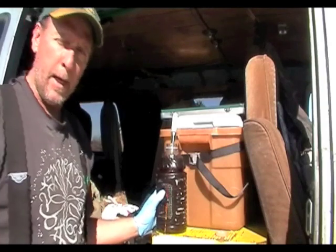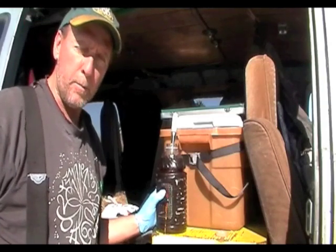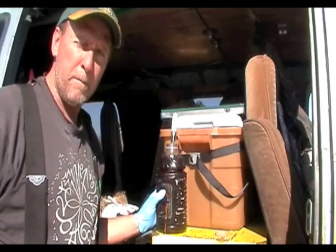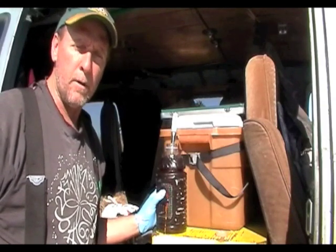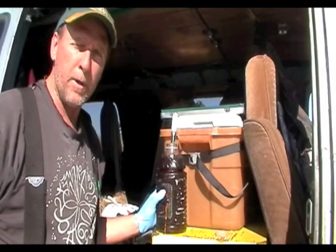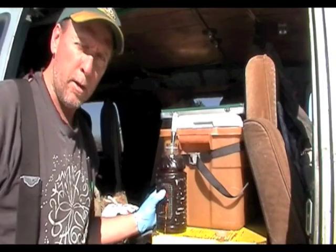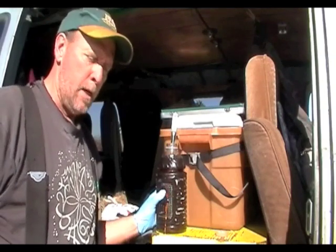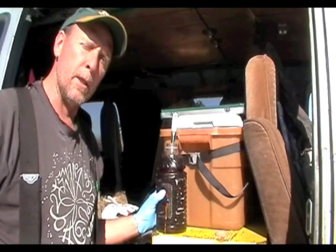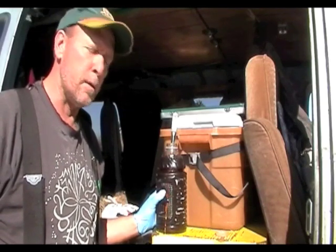And the reason why I did that is there are a number of reports on biodiesel forums where people who have been making biodiesel for a number of years have had their pickup screen plug on their fuel tank and then dropped their fuel tank and found there were all kinds of globs of things that had accumulated inside the fuel tank from running biodiesel.